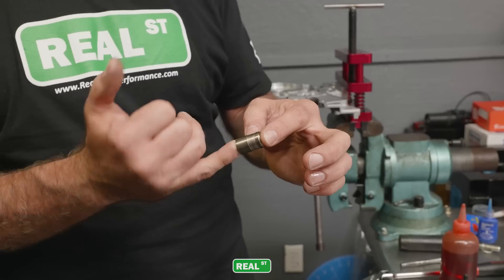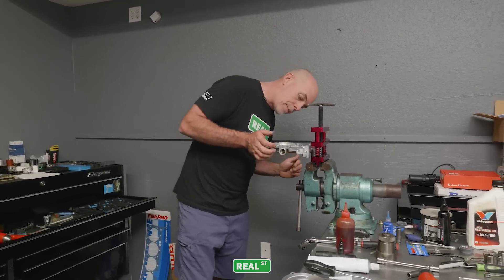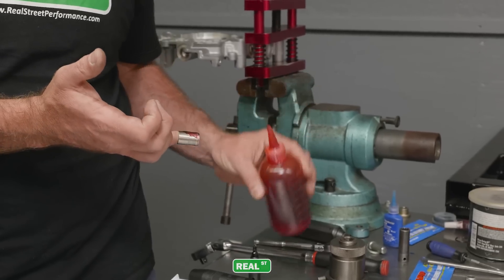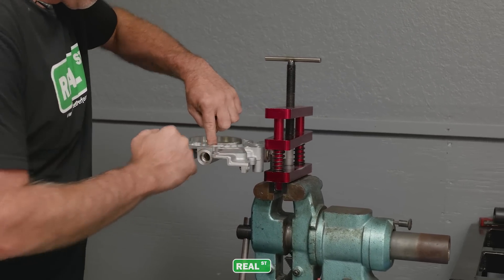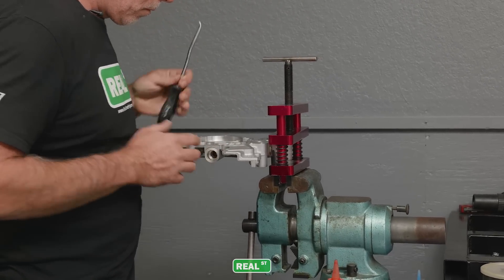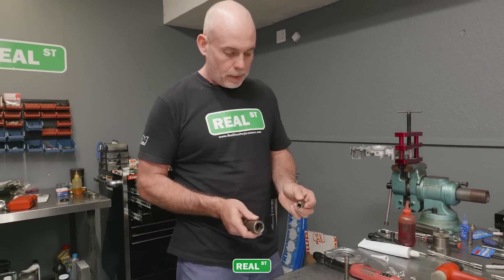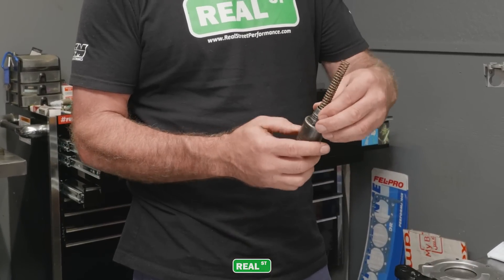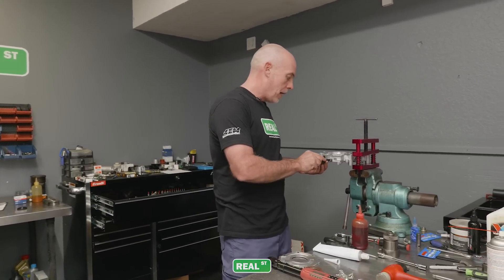This is all the piston is — and as you can see, it's dry. This pump hasn't been sitting around very long because there's no corrosion, but Toyota used to have these things really lubricated and over time it seems like they just got cheap with the grease. Now that I've lubricated the piston and it slides freely, I'm going to install the pressure spring back in. I'll drop a half-inch socket into the 24-millimeter socket I used to take it off — that gives the plug a bit of protrusion out of the socket so it doesn't get sucked into the pump housing and you can grab the first thread. Be careful with your hands as it's all pretty sharp.